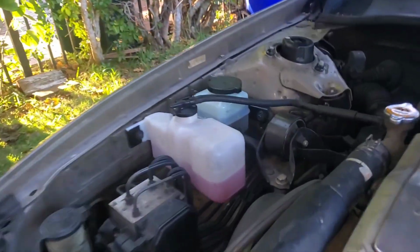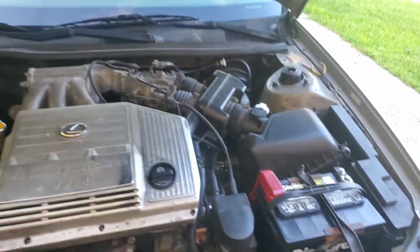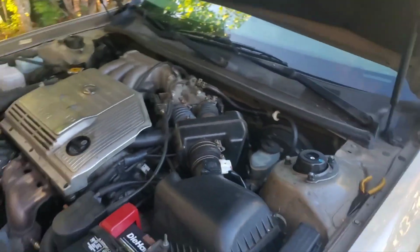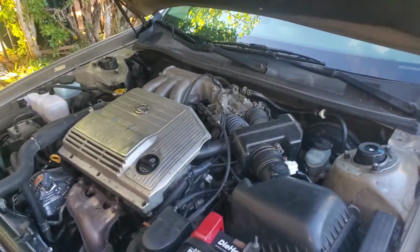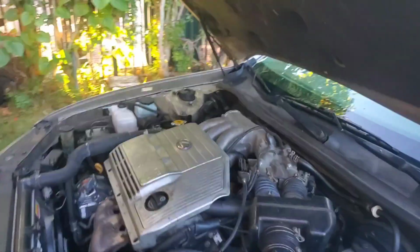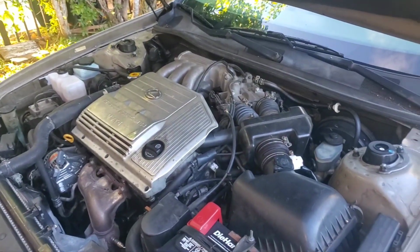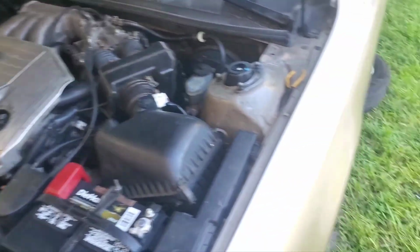We see to the current level. I mean, the car's been on, it's been driven, it works fine, but you want to make sure that you do bleed it first when the car is off with it connected, so there is that tension on it, and then turn the car on, go lock to lock, make sure there's no bubbles, get it up to the right level, and that's that.